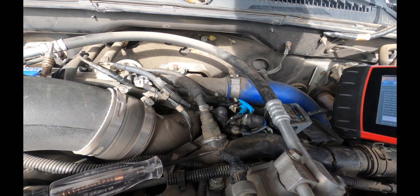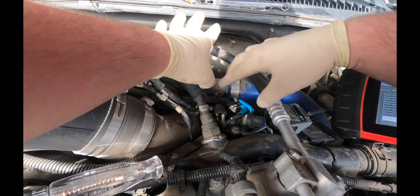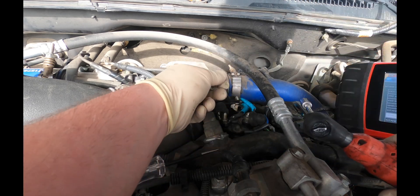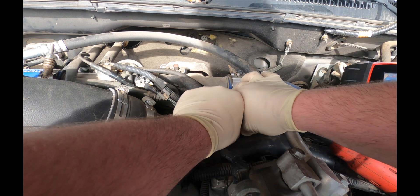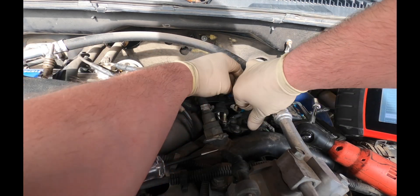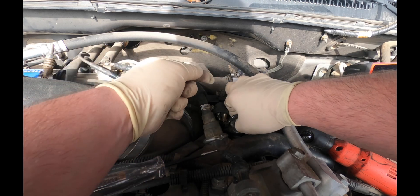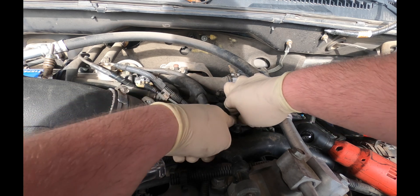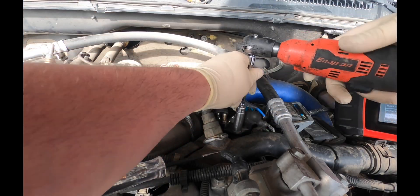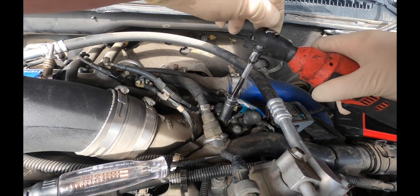This wire is for the feedback — it's not a ground. I do recommend if you're ever messing with this stuff, always unhook the batteries. I'm going to grab a socket. That's a 12 millimeter for that. We're going to take this off because this doesn't need to be on there. And if you're ever messing with electrical on a car, always unhook the battery. If you're not careful — even I'm not careful — we should cover this up so we short nothing out. The other one's a 13. Nothing crazy about it, just mounting bolts.